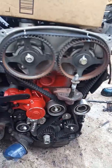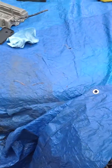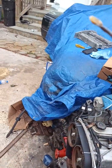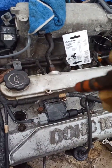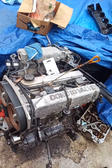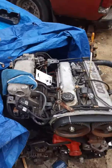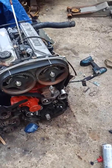All right, so what you want to do is, let me take this off. I'll show you another way here. Very important steps, okay? Grab your oil dipstick. Take out plug number one. See here? That tells me it's at TDC, top dead center, okay? Right there. All right, so let's say you just get this belt out. First thing,